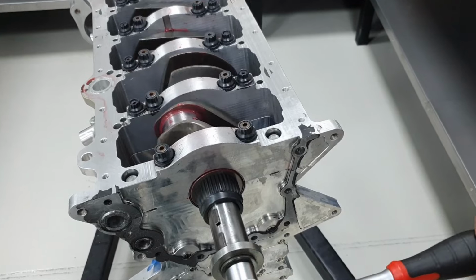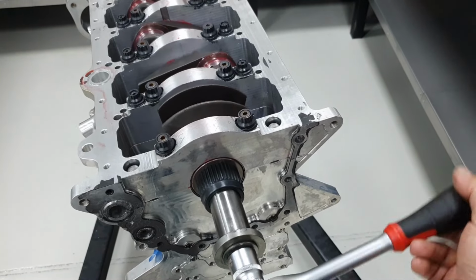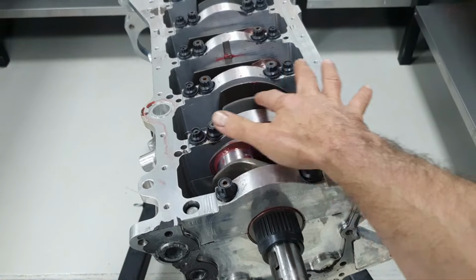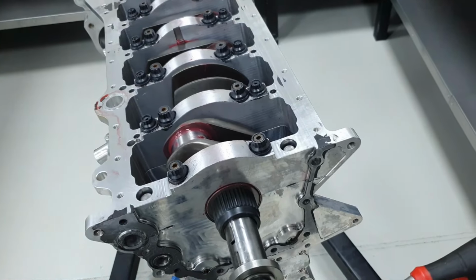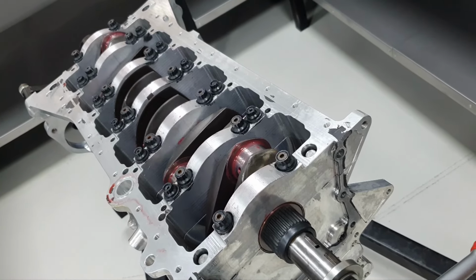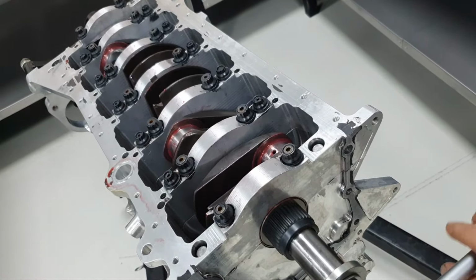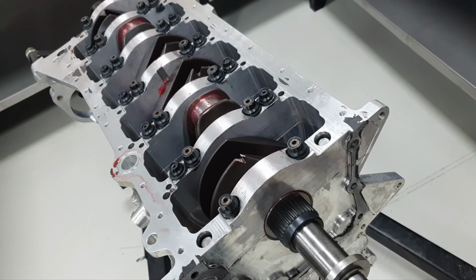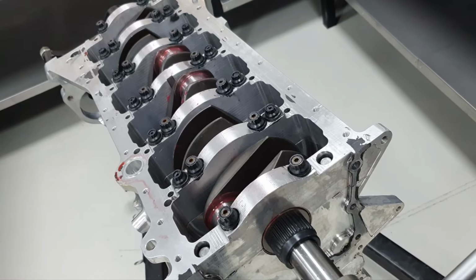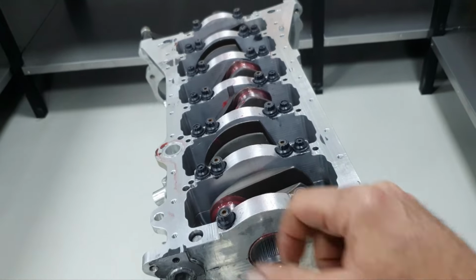It's just, I can feel the crank. Here it comes loose. Here it's much freer to spin it. And then there is one point that's stuck. There. If you see this counterweight, where it's located, you see that here it's a little bit tighter. Again, it has assembly grease on it, and I'm not using this assembly grease, to be honest. Then you come to one point, then it comes free. Here. And again, there is only a couple of degrees where the crankshaft comes free.